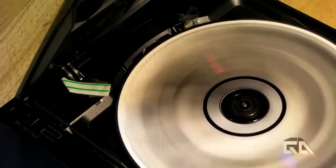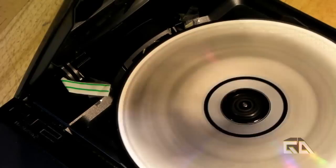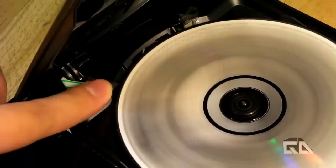And then we tape the straw down. You want to make sure you don't get the straw too long because you don't want it to scratch your disc. I had a friend one time where he did the straw mod and he really screwed up — he had a very nice circular scratch underneath all his PS1 and PS2 games. He really, really foobarred the straw mod. It was hilarious and sad at the same time.